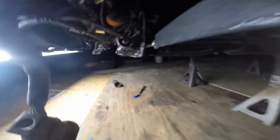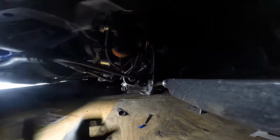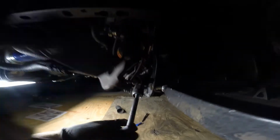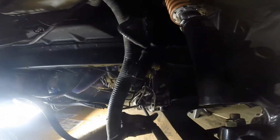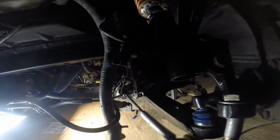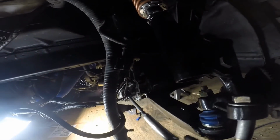And the main reason, I guess, besides obviously the steering geometry, the science stuff, for spacing the rack forward makes these inner tie rods last way longer. You can get a good season of hard driving without the rack spaced. You're probably going to wear the inners out. But if you space it, I mean, long-term testing, I'm going to do the second season on a set, so that's more than a year so far, just after spacing the rack.